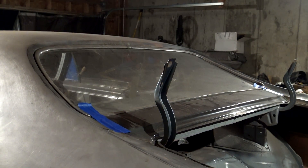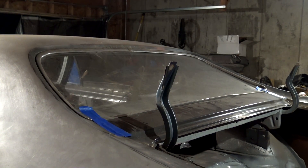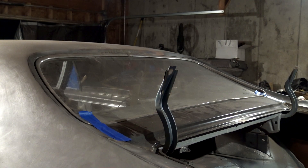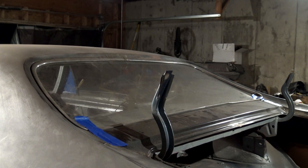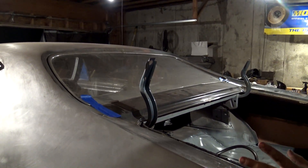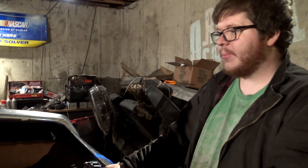The track is in there, and as you can see I have my old glass in there, which I'm not going to be using — I'm going to buy all new glass at least for the front and the back. But I threw it in there just as kind of a mock-up to make sure it still fits, and yeah, it fits well. There's plenty of room around it for the butyl and sealer. I also have my trim laying in there, kind of haphazardly taped down right now, but I do have all my trim. It's got one little hitch in it over here, but I'll be able to fix that. I can actually just push down on it with my fingers and it goes away, so it's not very substantial. It all lines up and I'm happy with it.